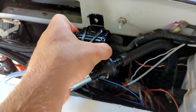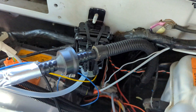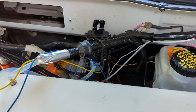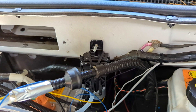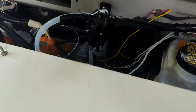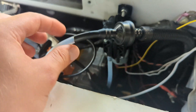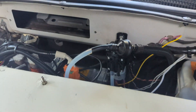The vacuum pump is going to mount right up on that bolt there that's protruding from the car — it's going to slide in there and then just get bolted on to secure it. I'm going to run the ground, negative, and just ground to the car. But I'm going to run the positive off the drive output from the BMS, so when I switch the BMS into drive mode, then it receives power — and it's not powered when the car is idling and not in drive. This is what the vacuum pump looks like fully mounted, bolted here to the firewall. This clear hose is connected directly to the vacuum line. I was able to remove the bit that I cut off so I could slide this right in and seal it with some heat shrink, and it seems to be holding a vacuum pretty well. I'm pretty happy with how that came out.